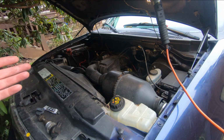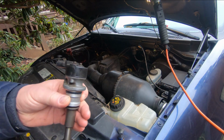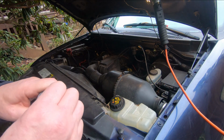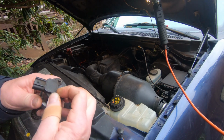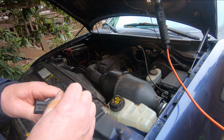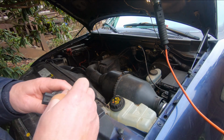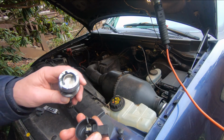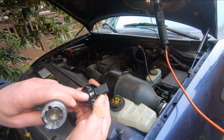And it's very similar to a symptom I had before when the camshaft synchronizer was failing. Actually, what happened was the seal in the synchronizer allowed engine oil to come up inside the sensor. So let me see if I can get the top off for you. This is the one that was in the vehicle when I bought it, before I rebuilt the engine. It's a perfectly good synchronizer, nice clean sensor and everything.